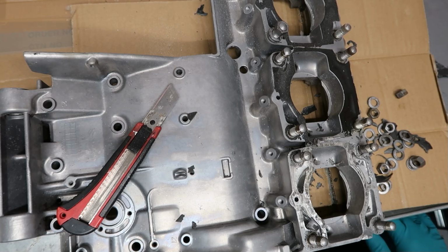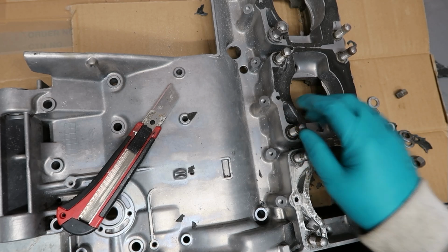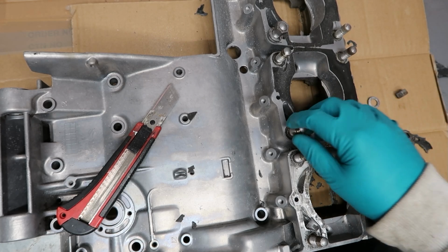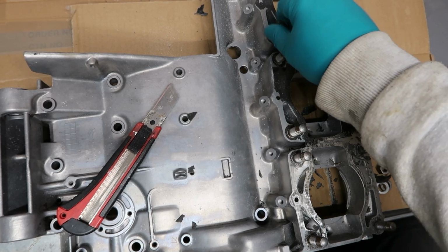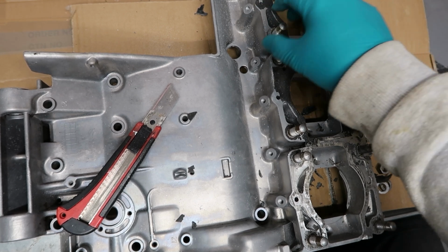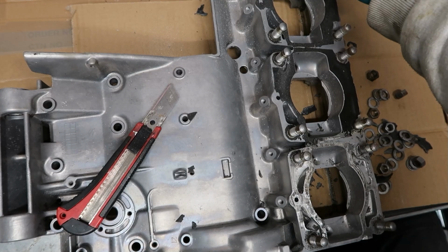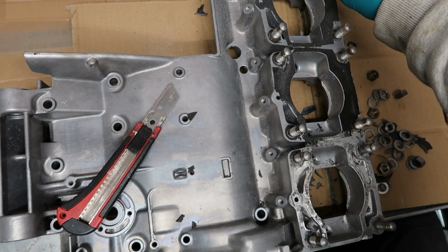So on big boats, big ships, big engines, it's not an issue because you actually go by bolt stretch. But for something like these, there'll be a torque for these, no doubt. Should be, I think. Maybe not, because it's just holding the cylinder in place. But certainly for some of them there'll be a tightening torque. So there are ways of doing conversions. I can't remember off the top of my head what that conversion is. If I was going to use copper slip, I would do a conversion and use the reduced torque. You must do it that way.